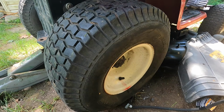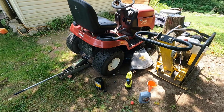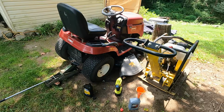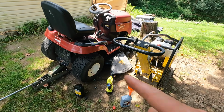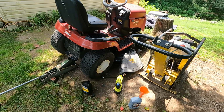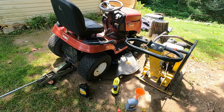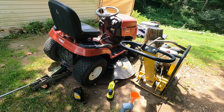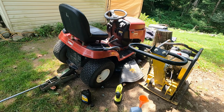That should do it. I'm going to try to spin those tires around a little bit, see if we can spread that ATF everywhere and make sure it seals all the cracks. And for a little pinhole leak like these have, this rear tire and the front tire, the ATF should do it. I find it to be even better than slime. I do like the Fix-A-Flat. It's real expensive though, so ATF is a budget choice.